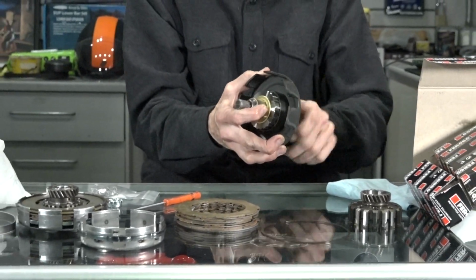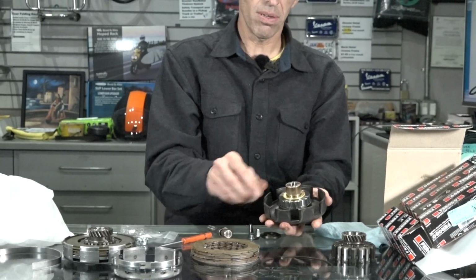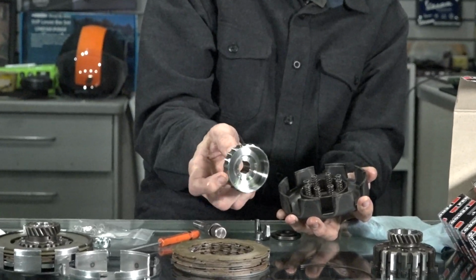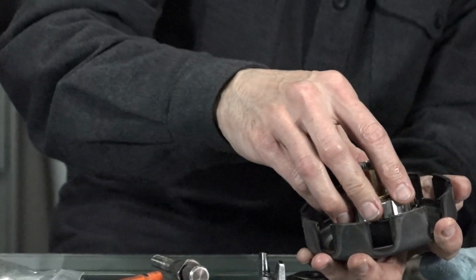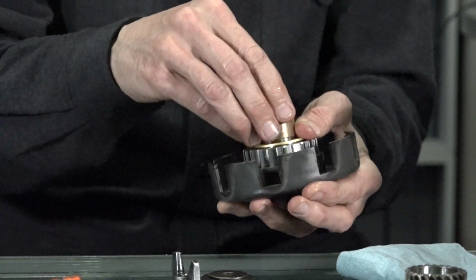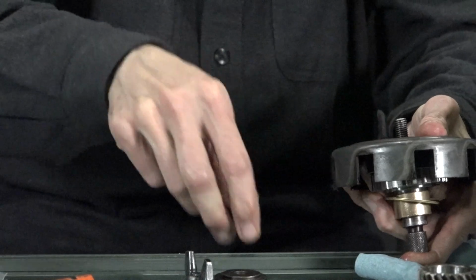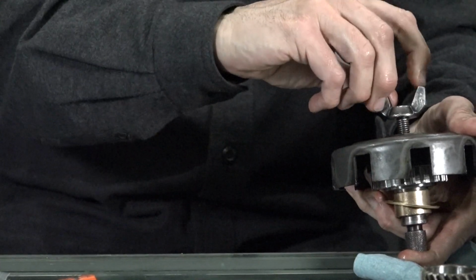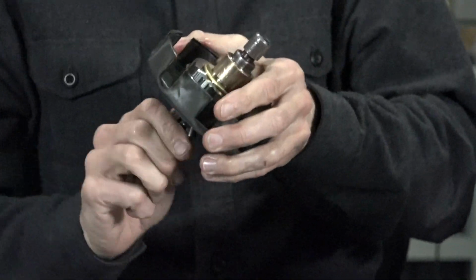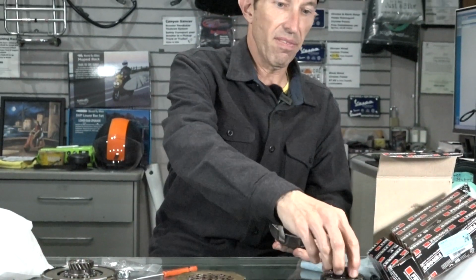So in some ways it's a much simpler setup. So you get the clutch tool out and you have that inner hub, and there's nothing to really line up, like little cups or anything. You can just see it's got this machined inner hub that kind of lines up with the teeth. So you kind of just line it up. You could change out those springs, they're just sitting on pegs in there. To compress it, kind of hold it all together, and then get the compressor started. Make sure it doesn't bind up. And pretty much goes together. Very similar to the original clutch that was found in Vespas since 1959 or even earlier.